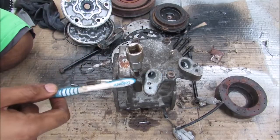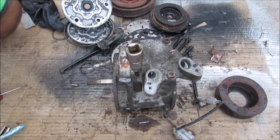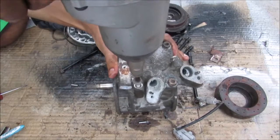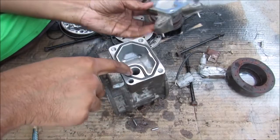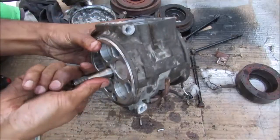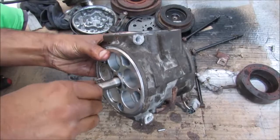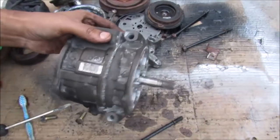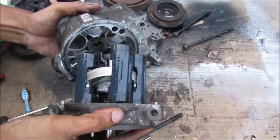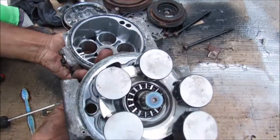At the top we have four 9mm hex bolts to remove. You can see we've got your inlet and outlet that lead into the compressor. In order to see what's causing the pistons to move in that sequential pattern, I'm going to split this case in half — here I've got it split open and I'm going to pull it apart to see what's inside.